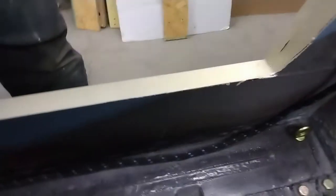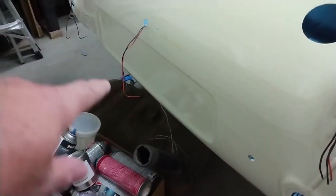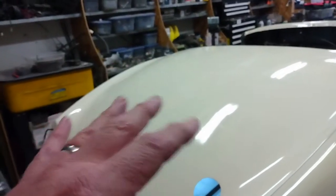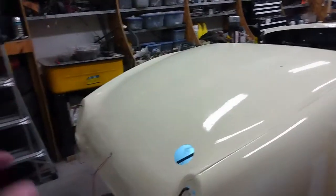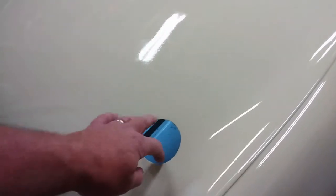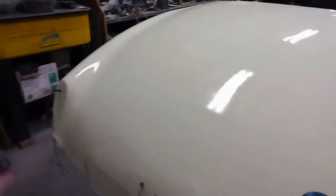The harness goes across here and then up into the big hole through the firewall. The main harness has a big grommet and this will be part of that, but that's a step for another day. On the outside I've got the wires sticking out their appropriate holes — you can just see the fuel pump wire hanging down there, license plate light, and wires in the right spot. I'm not going to install the lights until I've polished the car, which will be in another couple of weeks. Once it's polished I can also install the fuel tank. I'm looking forward to getting the Sprite badge on there — there are the two holes for it and I've picked up a new one, but again that'll have to wait till after polishing.